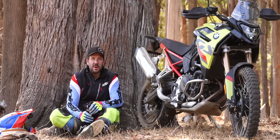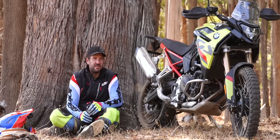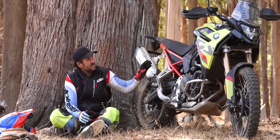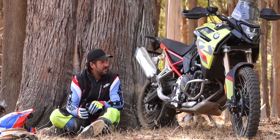If you were to customize it, even better. What I don't like — and I have this problem with the majority of the adventure bike range across all manufacturers — is the stressed member frame. Not that you're going to go jumping one of these expensive bikes, but when you load it up with luggage and hit the outback, there are massive washouts and g-outs you have no option but to case at 100 km/h. There's so much vulnerability under here. I'd ditch these crash bars straight away because they bolt directly into the engine cases — they seem pretty strong, and that's the problem. They need to be softer, to just mush in and be a one-hit throwaway. If they're really strong, you're going to snap these engine cases out if you go down.